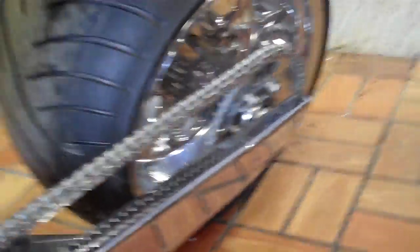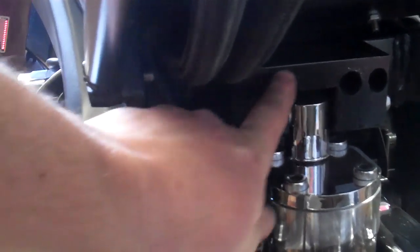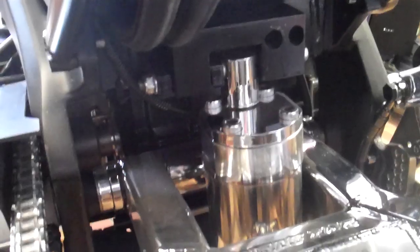As I said before, we're on a 330 OSD so we only have one chain running to the back, which makes it capable of keeping it real short. This is a two-over boost arm and we've made some modifications for the B-King so we could use the boost arm. Shims have been made. B-Kings are rear exit exhaust, so the exhaust comes through the right side. The mono shock bolts right there. You can see this is a block that's been mounted to the old mount and then back through the frame so we could run a boost-style dead-center rear air ride shock.